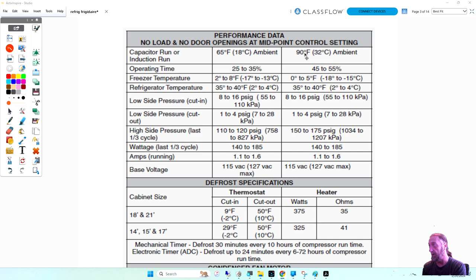So in other words, your condenser temperature, well, they don't really tell you that condenser temperature, but your condenser temperature would normally be about 110 degrees, 100 degrees, something like that, about 15, 20 degrees above the ambient temperature outside the box. But what effect would it have if the condenser was too cold? It will freeze ice faster than it's supposed to.